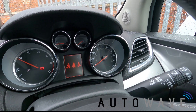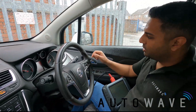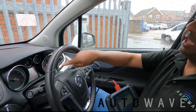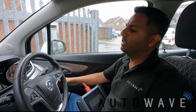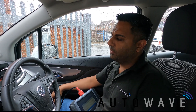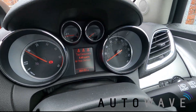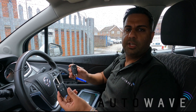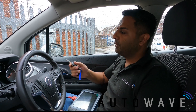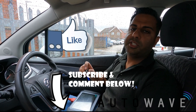The dashboard is on — obviously giving a seatbelt warning because we haven't got seatbelts on, but everything is good. I've cleared that message and as you can see everything on the dashboard is normal. I'll take that key out, put my original key back in, and start the vehicle — again everything is normal and working fine. So now I've got two fully working keys using an Autowave AUT RK0033 with a Vauxhall Mokka using the X-Tool Pad Elite. Thanks for watching — please like, subscribe, and leave any questions in the comments below.